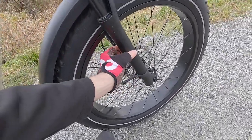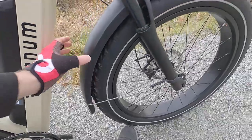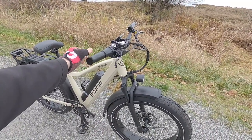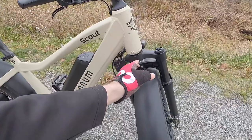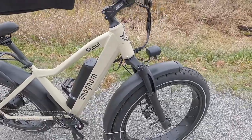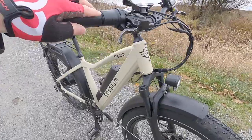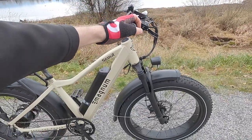They only come in black. Up front, the fender is okay, but you can see how it's mounted to the lowers of the suspension — not bolted directly, it's got a cuff thing which can slide around a little bit. Also you might notice that if I let go of the handlebar, it was back at home kind of tipping to the side. I've seen cargo bikes with a stabilizer spring from here to here to keep the front wheel pointed straight when you have that much weight — the wider rims, the heavy tire, and the suspension fork all affect the geometry and the wheel just kind of wants to turn a little bit.